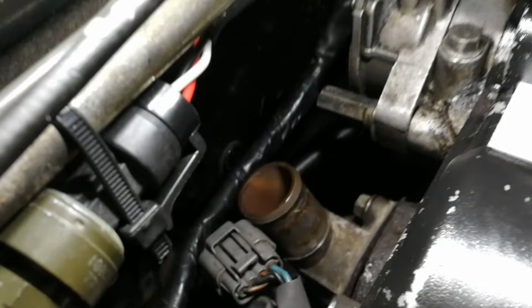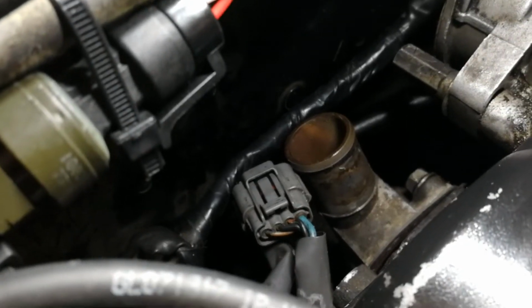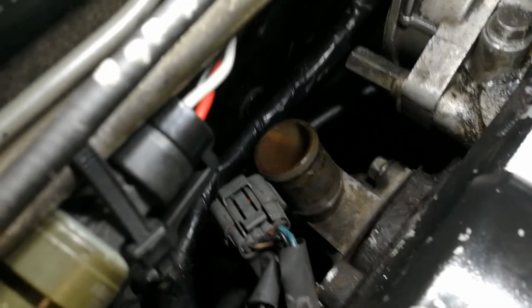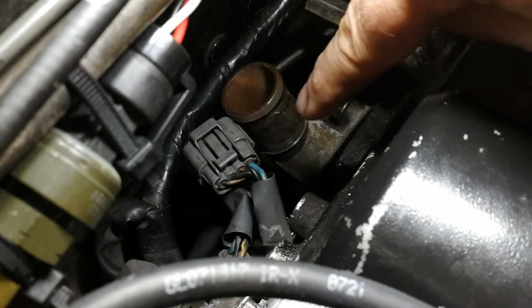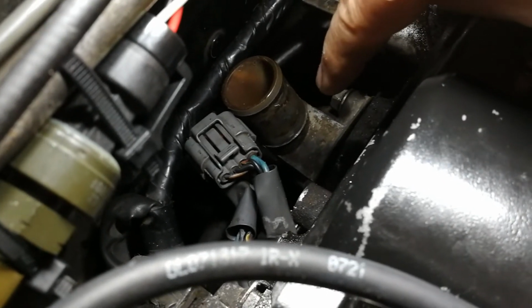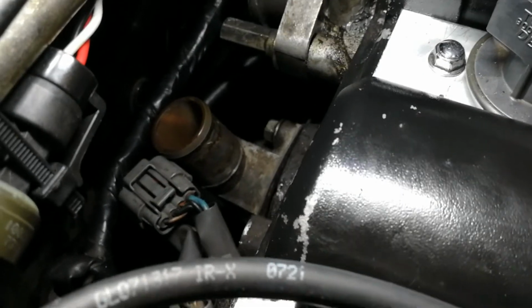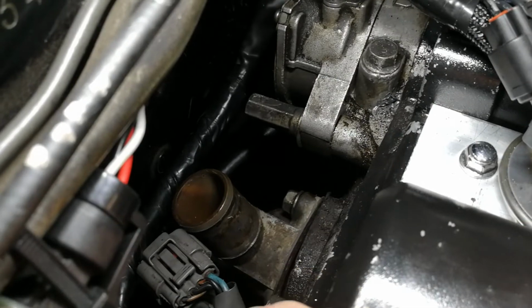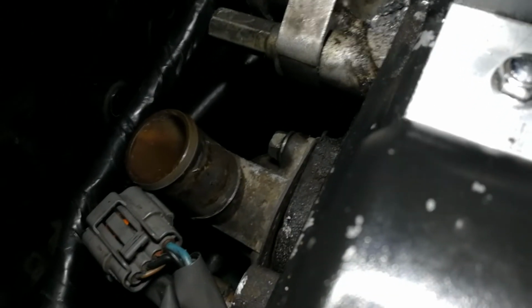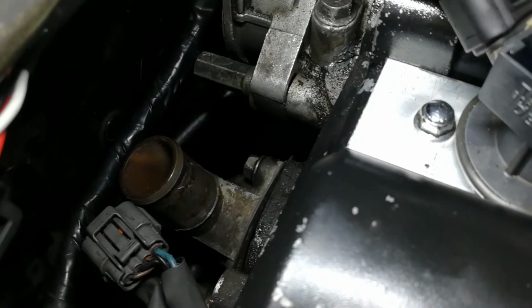All right, so coming around to the back, I've already got the back housing off and the new housing on, and this is a little bit interesting to get to because normally where that bolt is, right in here, the temperature sensor is coming out right there, and so it's kind of blocked a little bit, but you can get a shallow socket on there and get it out. I have a flex head socket driver in a 1/4 inch, and that allowed me to get in. You can also, once you get that hose out, come in from the other side and work on it like that. And the nut on the bottom is pretty straightforward because it's fairly easily accessible. Again, with the coil pack out, this is the coil plug right there, just laying there, and you can get to everything.